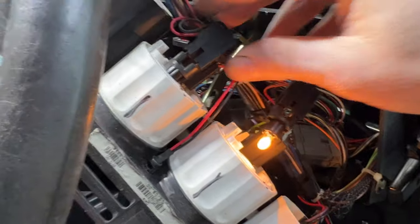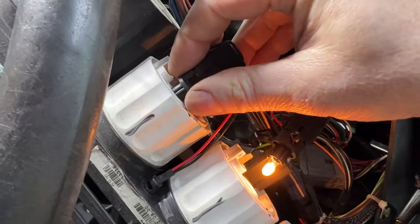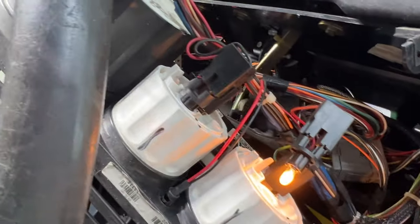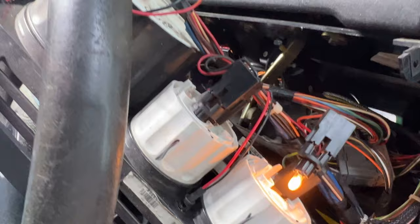There's the new one — they simply just push in, they don't turn, just push straight in. Looking at the old bulb, it's still glowing; they're the same brightness, so I'm using 12 volt 1.2 watt bulbs. I'll put all the links in the description — part numbers etc. Now we'll move over to the speedo.